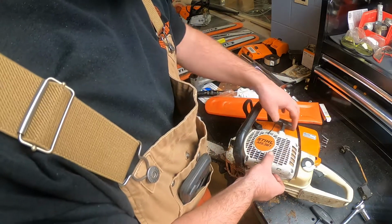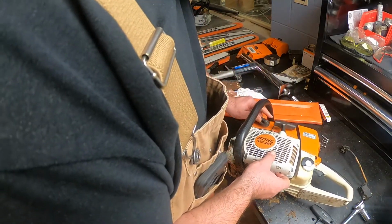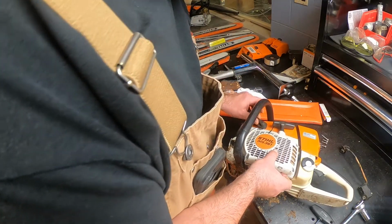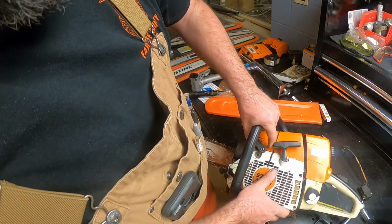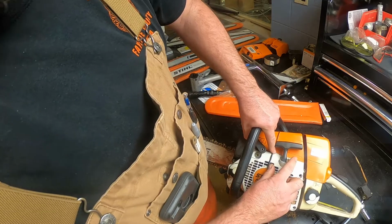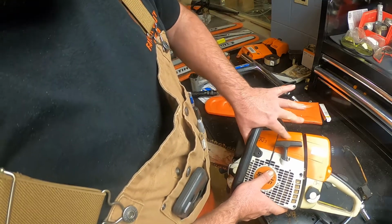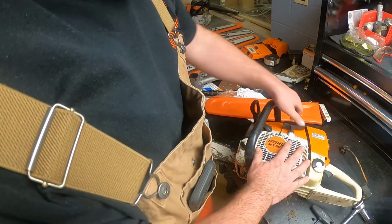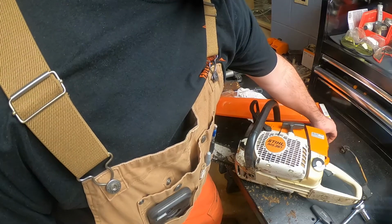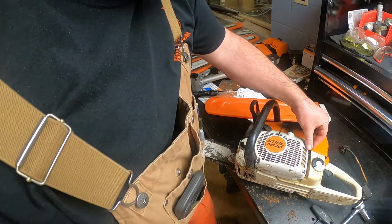And the other thing you got to watch is make sure there's two tabs on the top. If you put the top cover on first, make sure you can see those. See, I'll put it on wrong here for you. See how those tabs are sticking up right there? That'll give you a problem. So you want to make sure that you get those under there. Even if you put this on second, it's not a big deal. And all those feel good. It went in nice and neat. So then we'll install our screws.